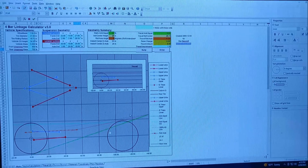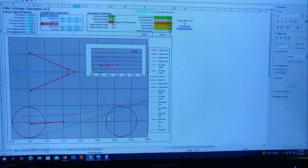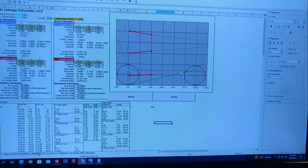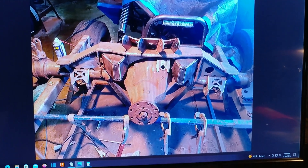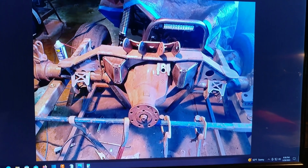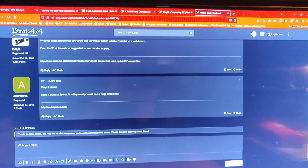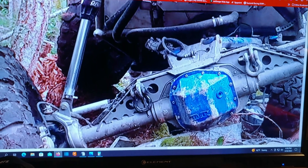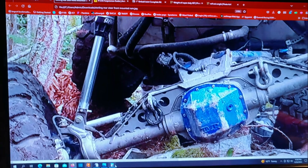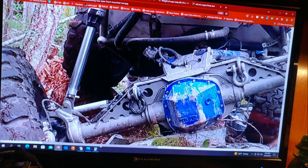This is the four-link calculations I've come up with. Those are the numbers I'm aiming for. That's an axle I found online that I'm kind of going to mimic — doing a front-mounted ram. I don't know where I'm at up here. That is the same rear end and back. I've got some pieces to make; I've got to design the upper link mounts. But that's kind of what I'm going to mimic — I thought I'd toss that in here.